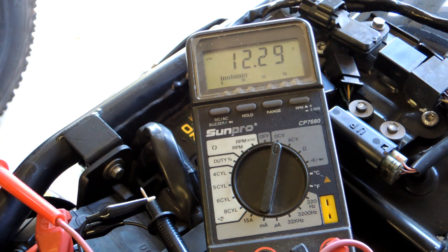If it starts going way below that, the charge is really very shallow and there's not much to it. Now I'm going to pull the clutch in and try not to hit the camera. We'll start it up and watch how far down this voltage dips.